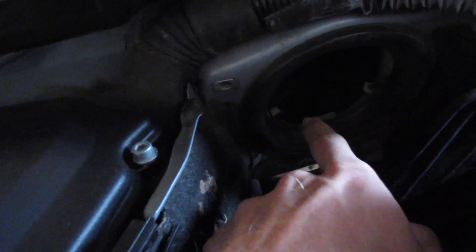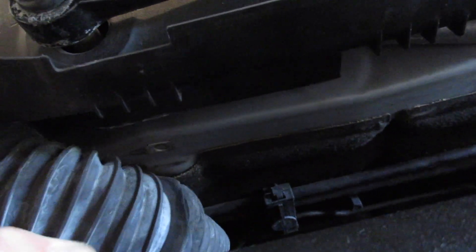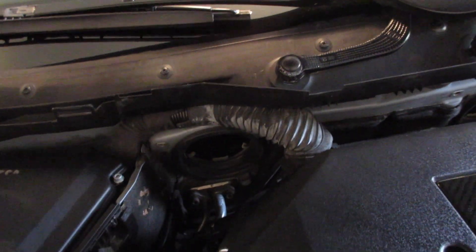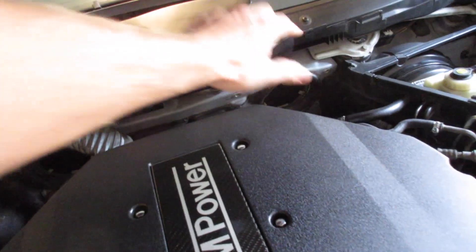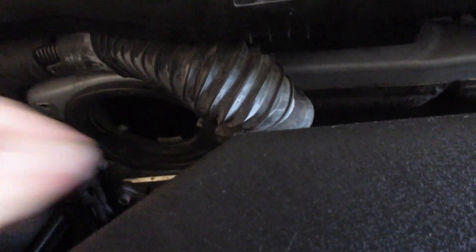It's really a straightforward install or uninstall. Once you have those hoses out of the way that go to your airboxes, there's one of those metal clips. There should be another one there, a third one here, and a fourth one there. In those are the twist-and-locks — turn them 90 degrees either counterclockwise or clockwise, pull them out, and then you'll have those three clips up here. Just lift those off — they're like little hands that hold it on. Unscrew the four twist-and-screws and then you should just be able to pull it out, being careful of the engine harness right here.